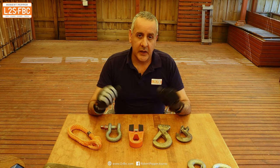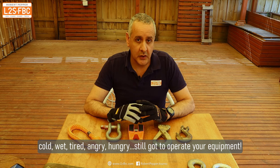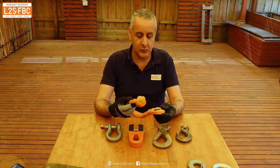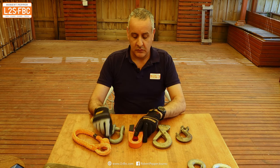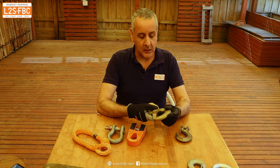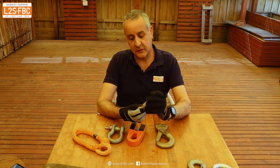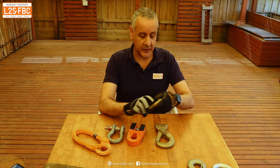I'm wearing gloves for the next criteria, and that is usability. Imagine it's wet, it's windy, it's late at night and you're struggling to do a recovery in the depths of some godforsaken forest. The soft shackle is pretty easy to use - no small fiddly parts, which is great. The bow shackle is also easy to use with gloves. The flat link needs one of the other two alongside it. The big hook is easy to operate and works quite well. The only fiddly one is the small hook's latch - in my experience this one's already a bit bent, it tends to get worse and the spring tends to fail. So it's just a bit more fiddly and not really all that usable in the bush.